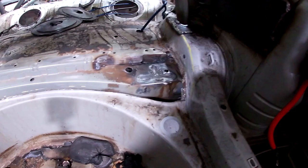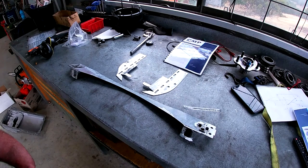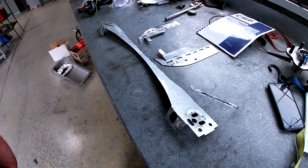We've done the underside of the car now, reinforced with those plates from CMP. Now we're going to focus on reinforcing from the top side of the car. Basically we need to find the points where the subframe meets the car and reinforce those to something structural - like a chassis leg, chassis rail, or the roll cage. We've removed this panel and had to unstitch it to get to where the subframe actually meets the car. We also had to get the oxy out and knock this section down so that we can fit plates on it.